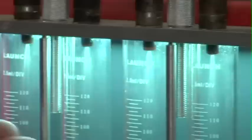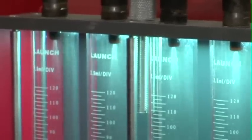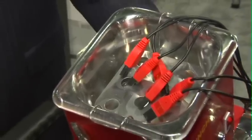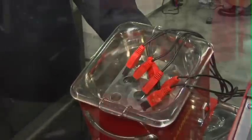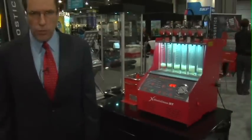So if you have an injector that isn't spraying like it should, what do you do? Do you just replace it? Not necessarily. We can actually recondition that injector by simply running it in our ultrasonic bath. As it sits in the ultrasonic bath, the computer generates a pulse signal to open and close the injector pintle, ensuring that it comes out like fresh and new.